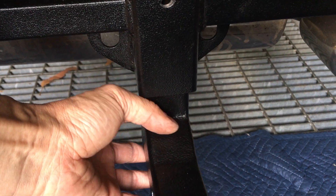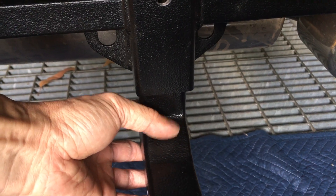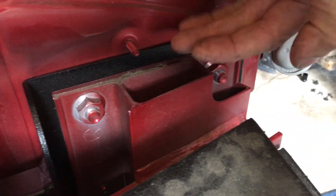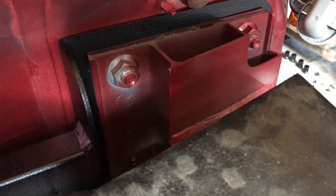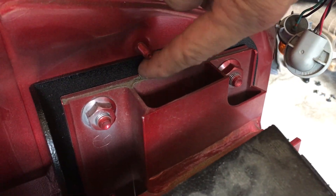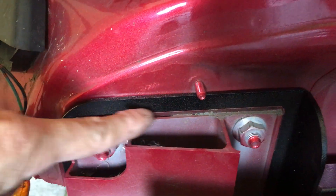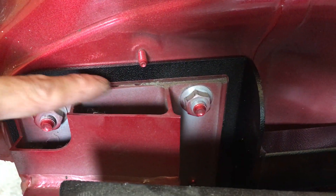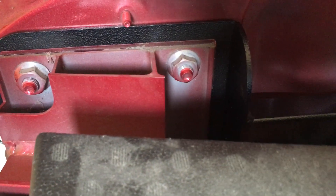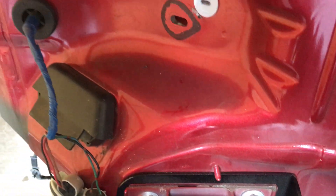Because I have the club model with the arrow underskirt, it actually hits right here. So I have to move it down — I think about half an inch. Right now I have the hitch up as high as it can go. What I'm going to do is push it down until this top edge is basically even with the bumper edge mounting plate. That should be more than enough clearance.